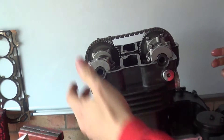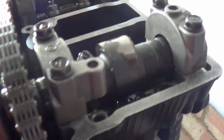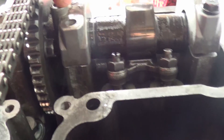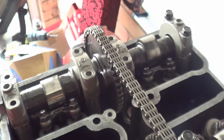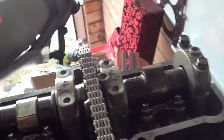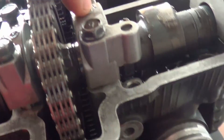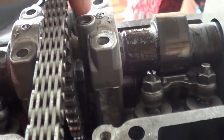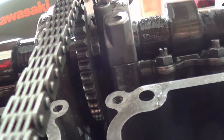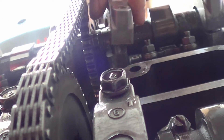Oh, that's not right - something's not right here. So there's a cam cap here that says C, and then there's this mounting point on top which is for the oil system or what have you. On this side on one cap we have a nodule here and then the oil feed right below it, and on that one it's sat there and that doesn't look right to me because it looks like that bolt on the cam sprocket is going to hit it when it turns around.